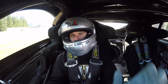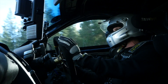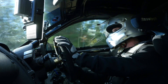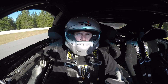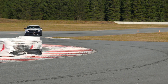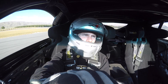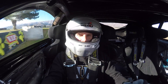Out on the track with our initial high tyre pressures, we find that straight away right from leaving the pits the car is really easy to drive. The car points and turns into corners really well and it's really quite stable. What we do find though is that the car doesn't have a huge amount of grip in some of the low speed corners where it's naturally a little bit traction limited, so the car can be a little bit skatey coming out of those corners. We have to be a little bit careful with our throttle application to make sure that we don't lose grip or traction.